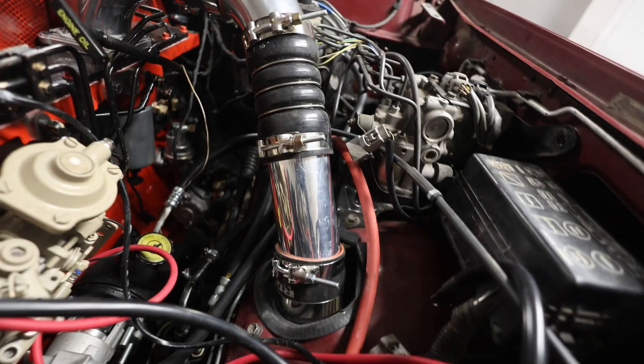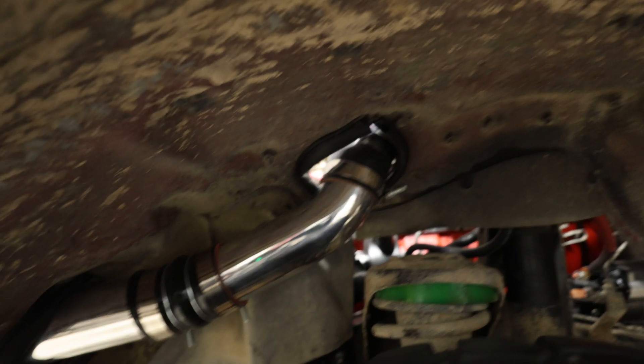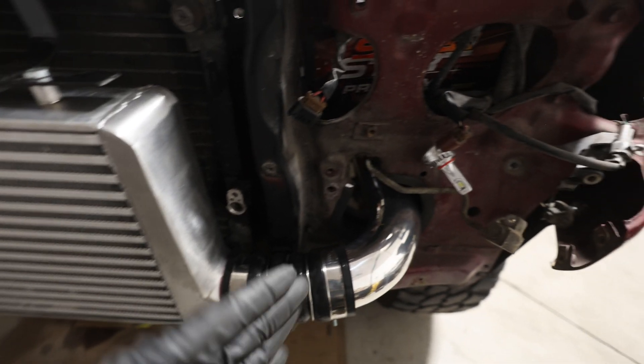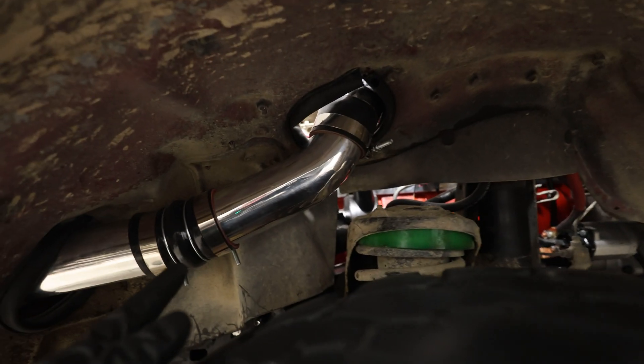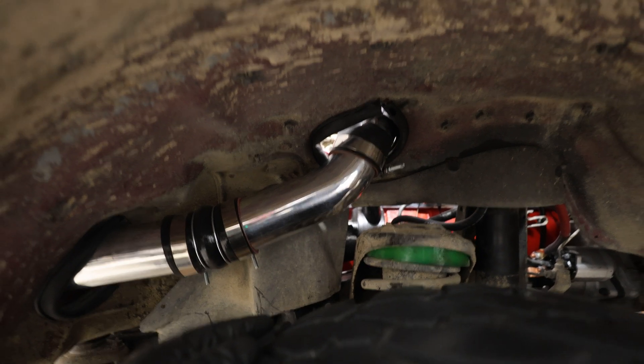Now everything is secured and fastened in a good way. We cut another section of pipe here — again, more cuts than I would like, but it's going to work. Here's our intercooler piping routing, and we used a double hump hose on this front section to try and get more angle to bend in towards the frame, because this will be a continuing problem as we grow in tire size and try to tuck bigger tires up in the wheel well.